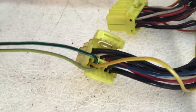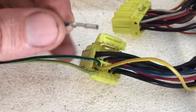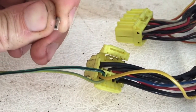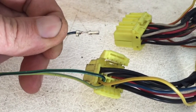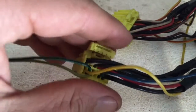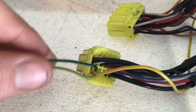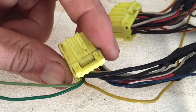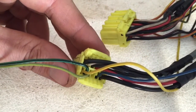To get the pins out, they look like this — similar to other ECUs. I just give them a good hard tug and they come right out. Then you just make sure everything lines back up and snap these back in. Pretty simple on the four connector 90 to 94 Subaru ECUs.